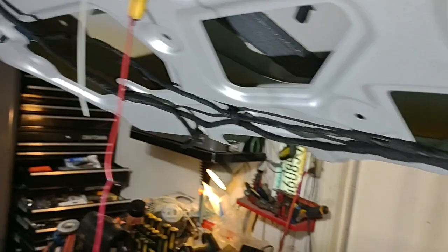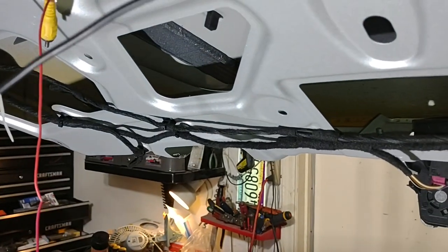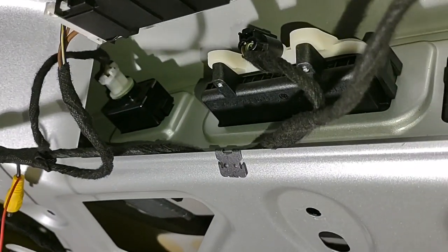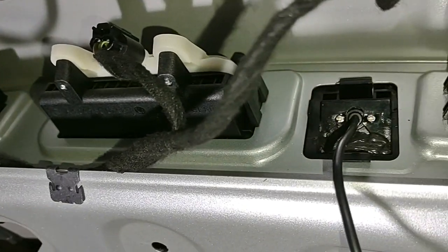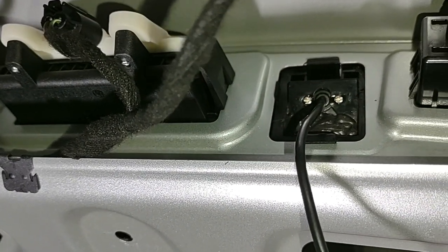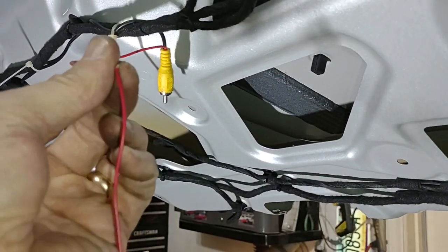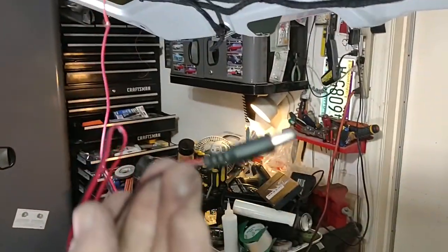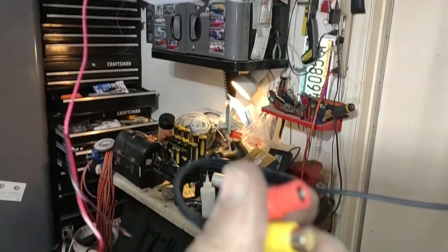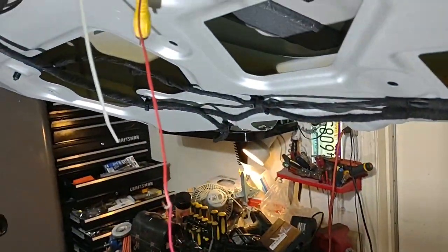That's how close the two wiring pieces are together, and I barely had enough cable — maybe an extra foot. So be cautious about that when you order one: make sure you're getting a long enough cable to reach all the way to the back. I have my hot wire coming in from up front going to the plug that will power the rear view camera. What I don't have yet is a ground.